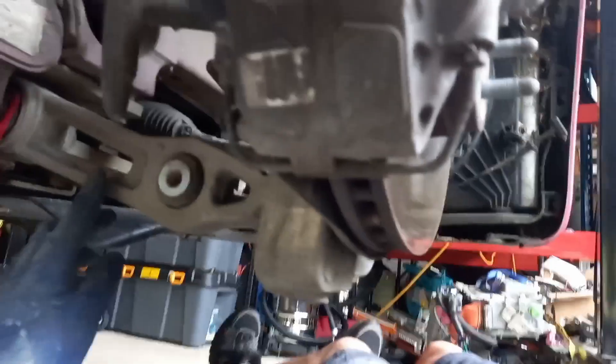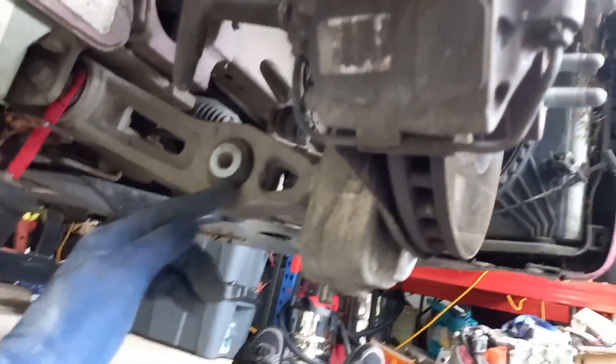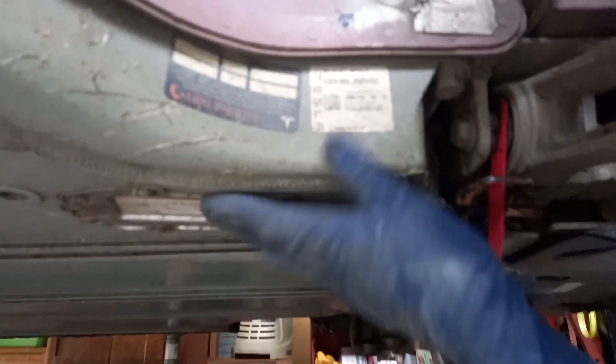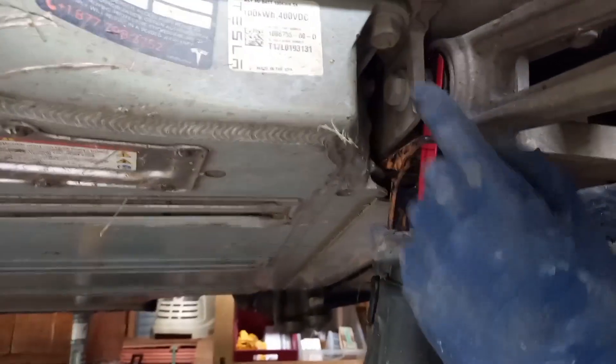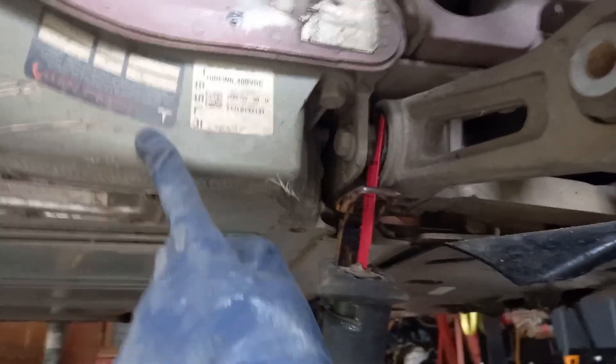You generally replace that by changing the whole arm with the various joints in it. Currently there are a few bits missing. However, Tesla, when they assemble this at the factory, put this bolt in when the battery is out, meaning that when you want to take this bolt out and consult the service manual, it says drop the battery. Well, bugger that for a game of soldiers.